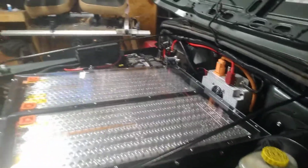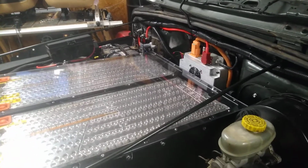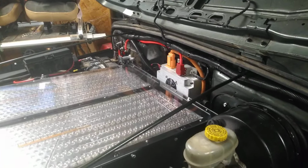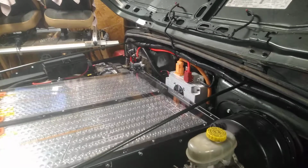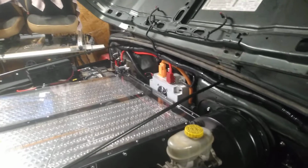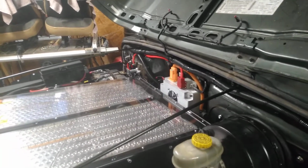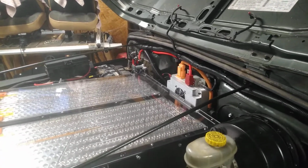As far as servicing goes, this is a Brusa charger, and I know that these things just work. They work really good. I've got it connected at the moment to run off of CAN, so the Orion will, I hope, effectively control it. The Orion would control when the charge stops. Alternatively, I can just program the Brusa to stop charging when it's time to stop. That's what I do with my Ranger, and it's probably what I'm going to do with this, just for simplicity's sake. So I'm just extraordinarily happy about that.